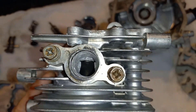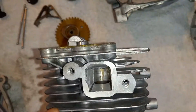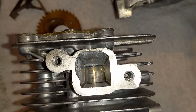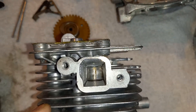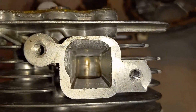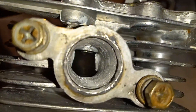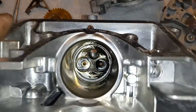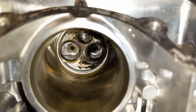Porting this was a pain, but I did it. I kind of rounded that corner a little bit because of my intake pipe. I've done better port work, but it's so deep in there it was really hard to do. It's not like you can get at it from both sides either — with a removable head you can get in from the other side.